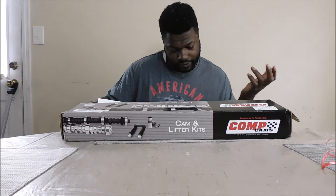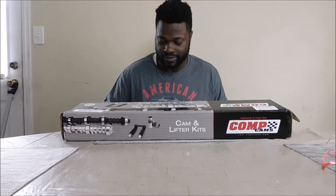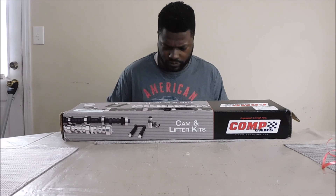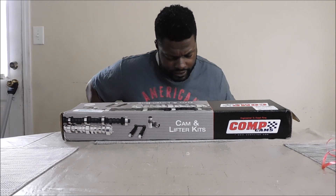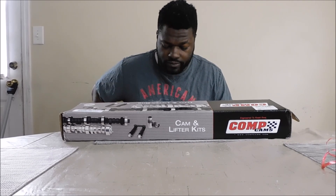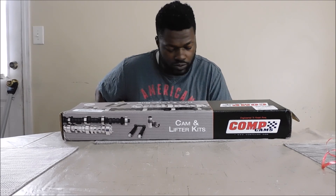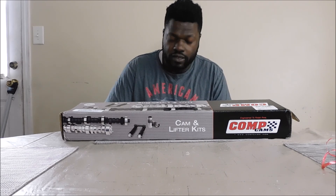This is mostly just the instruction guide. Most mechanics already know what they need to do to make this cam and lifter kit do what they're supposed to do, but this is basically just a thank you note and some of the instructions. These are flat tappet cams that require dual valve springs — the inner springs must be removed during break-in. Also, they do not recommend use of synthetic motor oils during the process. Comp Cam recommends using part number 1590 10W30 or number 1591 15W50 engine break-in oil.